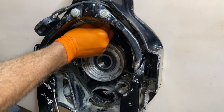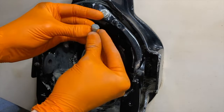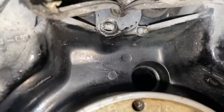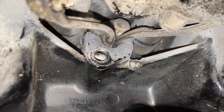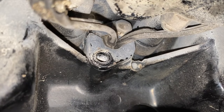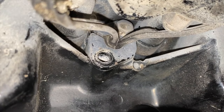As you unscrew that, you can carefully move your gimbal ring to give better access to that bolt, and switch to the smaller quarter-inch so you don't jam the ratchet and socket in place between the bolt and gimbal ring. It is now loose to a point where I can unscrew the bolt by hand — just shy of an inch long. Coming inside, there is the hole that the bolt came out of, and above that a second bolt. For all you Alpha 1 Gen 1s, you have that second bolt. Alpha 1 Gen 2 or any of the Bravos — you are lucky, you do not have that second bolt.